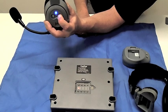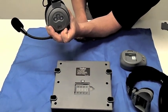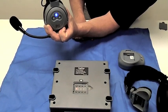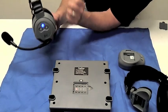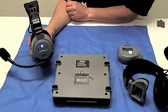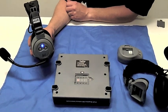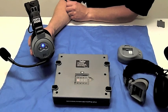Once both blue and red lights are solid, release both buttons. The LEDs will remain solid while the headset is automatically linking to the comm center. This syncing process can happen quickly but might take up to 30 seconds. Watch the LEDs on the headset and comm center — they will both momentarily turn off and then come back on and remain solid, indicating that programming was successful.